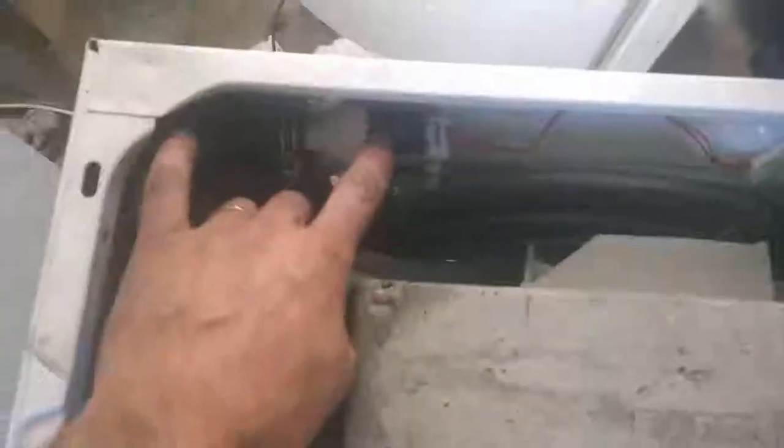This is actually very simple to repair and I'm going to show you how to do it. First, let's get an overview of the components on this machine. We have the water inlet solenoids here — these are coils that open or close the water for the machine. We have two of them because we have separate compartments for detergent and softener. And we have our control module here — this is where the fault is.